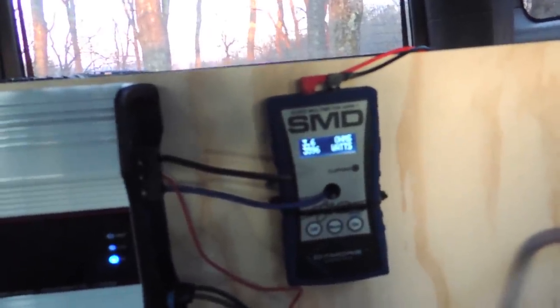All right, yes, at 47 hertz, guys, look at that. Got to 140 in a really, really big car on a 300 watt RMS sub. Let's take a look at that right there, 3,596 watts. All right, guys, I hope you thought that was as awesome as I did. Again, on a 300 watt, $90 sub, we got to 140 dB in a car that is massive. Some people don't even get that, and they have a little teeny truck. So again, guys, really am very impressed so far.